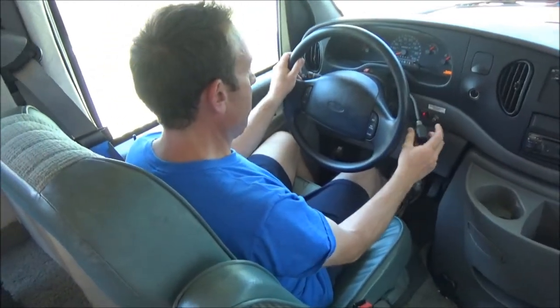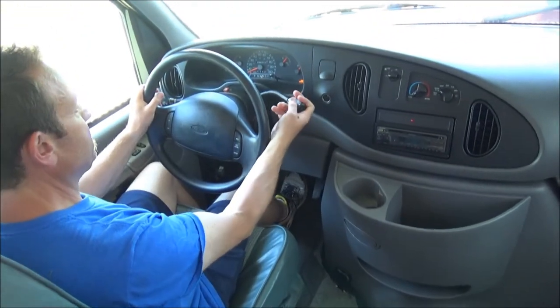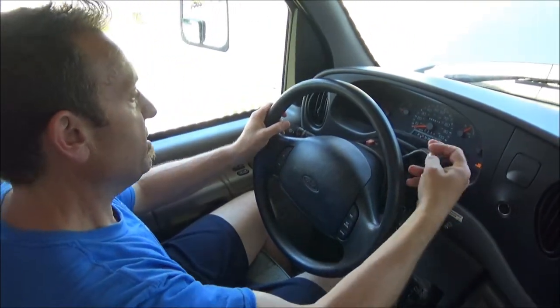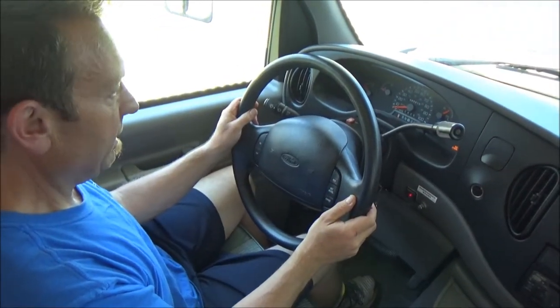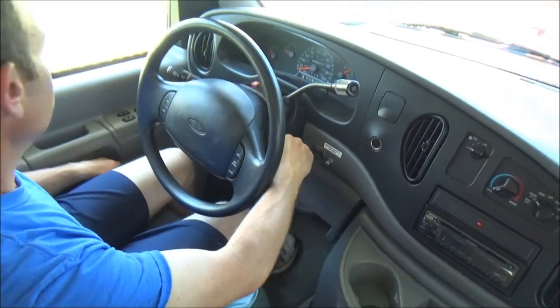So I'm actually in the cab of the truck right now, as you can see. I've got the engine started, and I'm simply putting the gear selector through the gears, because what it's doing is pumping that fresh fluid that we just put in around the transmission. In reverse. And then in park. That seems pretty good right there — feels like it's moving around all right.